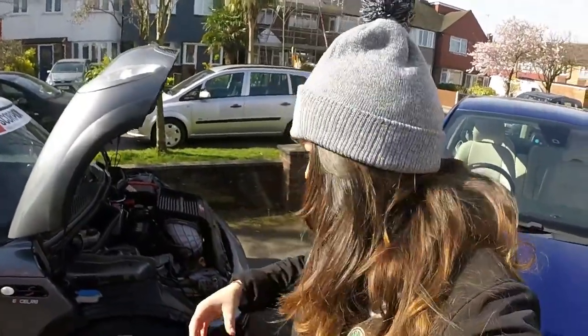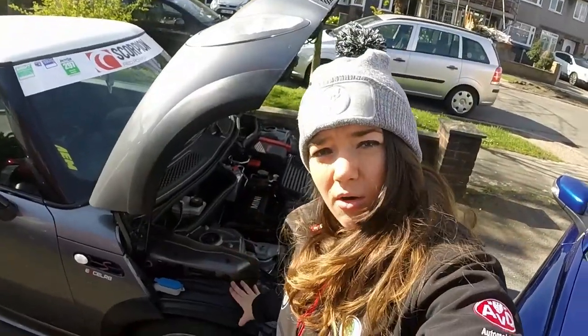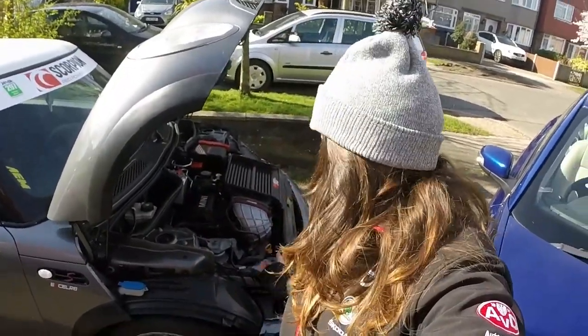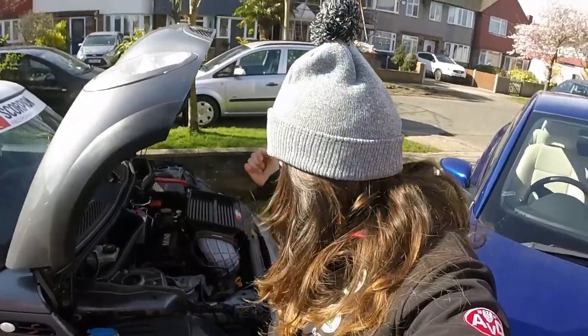It's a really distinctive tinny noise, like a really high-pitched tinny noise. Some people say it sounds like it's whistling. To get access to that, I'm going to take the wheel off, take the wheel arch liner off, take the belt off — I've got to deal with the belt tensioner as well to do that — and then we're going to get that all pulled apart, take the old idler pulley off that's failed, put a new one on, put a new belt back on and then we should be good to go.